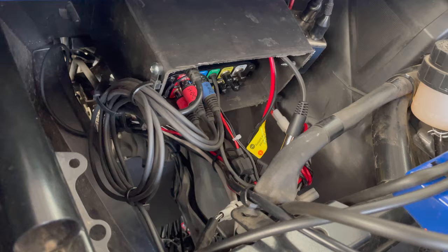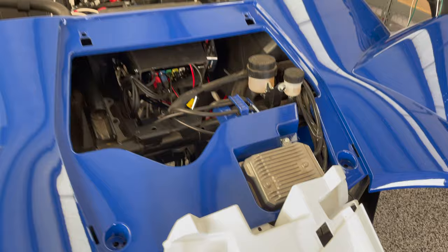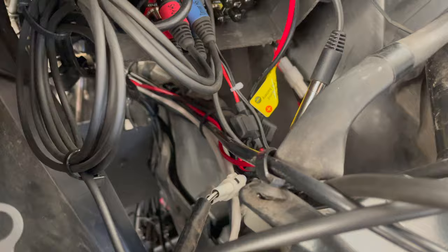the front plastic pieces here, so that you can see that we still have pretty good access. If you just pop off this one hood piece, you have good access here. Of course, like I said, the drawback is that it's pretty exposed, but this is nice, serviceable access. I basically just run the wires up the factory snake harness. You can see there, I even use some of the factory zip ties right there as it goes up through the console.